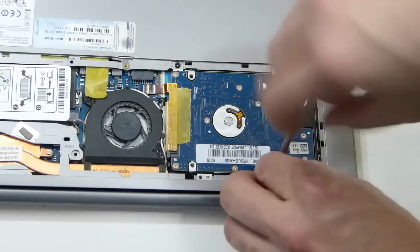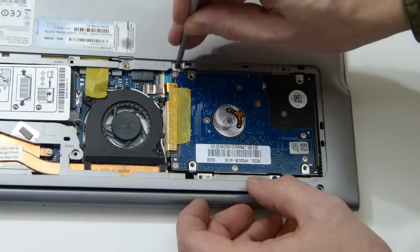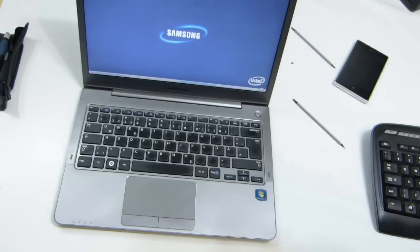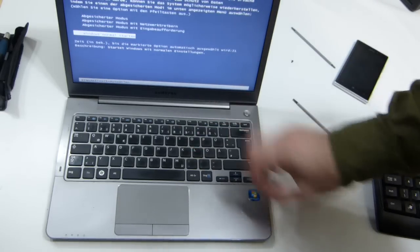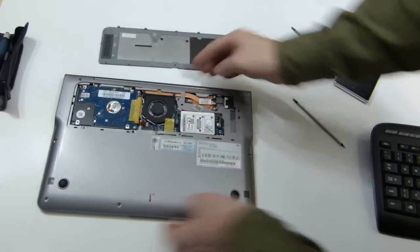It sometimes helps to put a bit of Blu-Tack on the end of your screwdriver so you can pick up and hold the screws. I'm going to flip this over — I've got a plastic mat underneath, so no worries. Don't do it on a metal table. Moment of truth: I'm going to push that button and see if it comes on. Batteries should be delivered with some charge — yes, excellent! With the old battery nothing was happening at all, it wasn't even charging. I'm glad it's the battery that was broken and not the charging system itself.